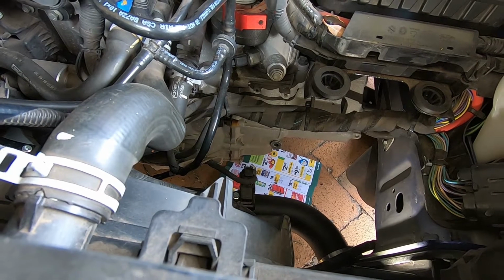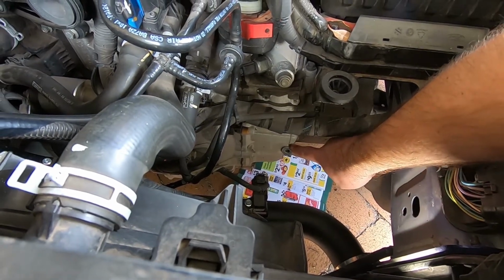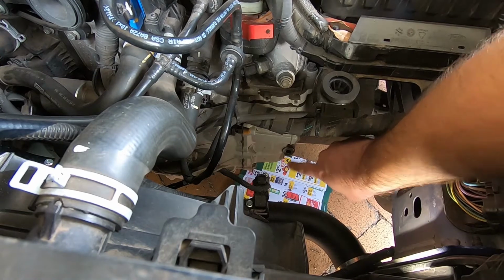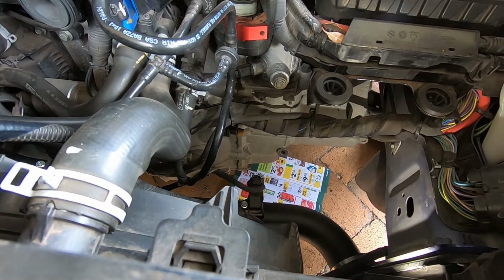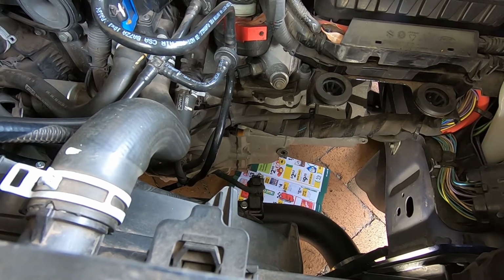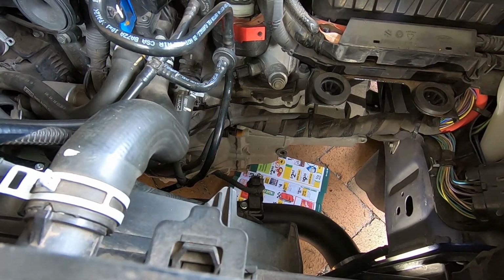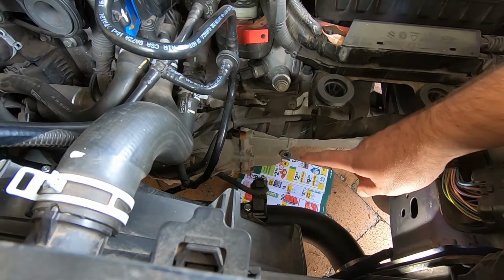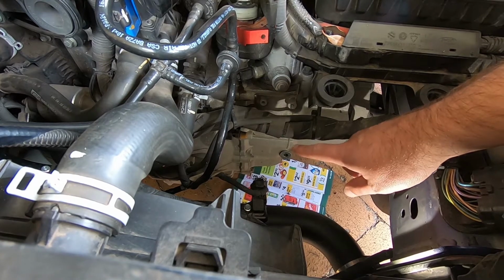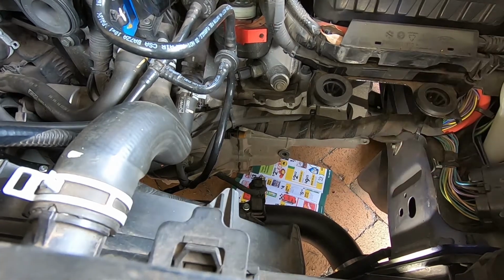With the airbox removed, we've got heaps of access now. So this is the fill plug here. It's an 8mm Allen key, so I'll get that out. Mitch, who did the last oil change, if he's done it the caveman way, fill it till it drips. It may drip a little bit, but otherwise it should be okay. And I'm going to get the syringe in. It's got 2 long hoses, and I'm going to take out 250 mils, and then I can put the shift ease in.